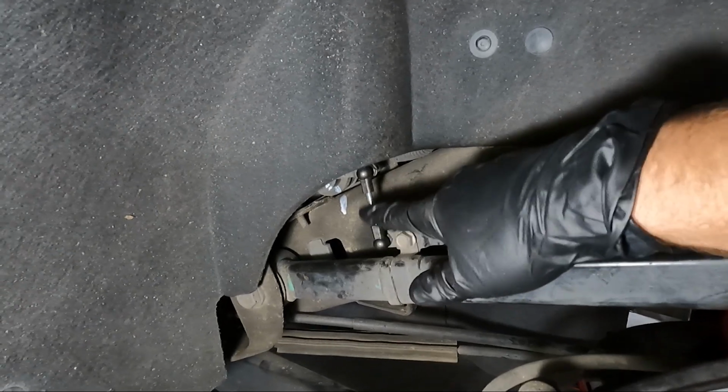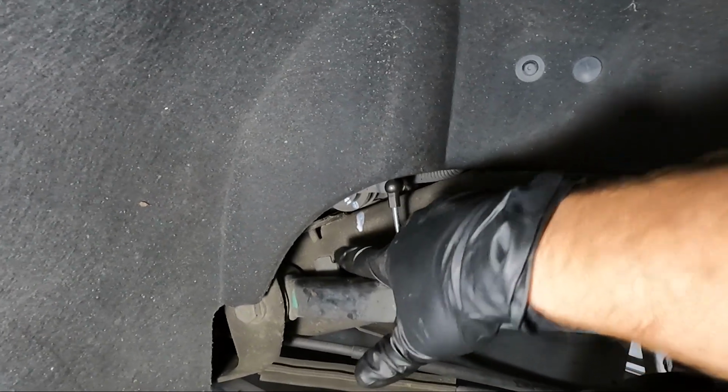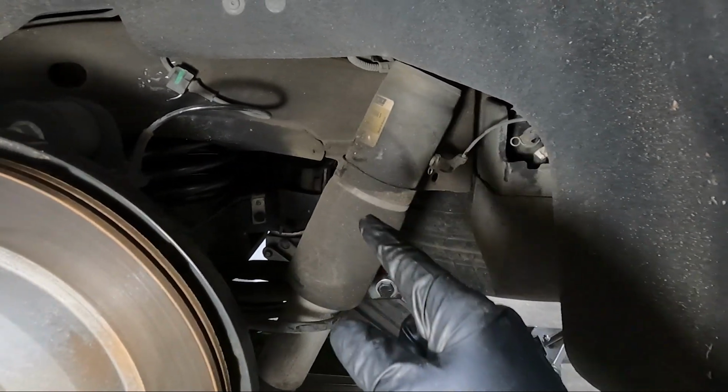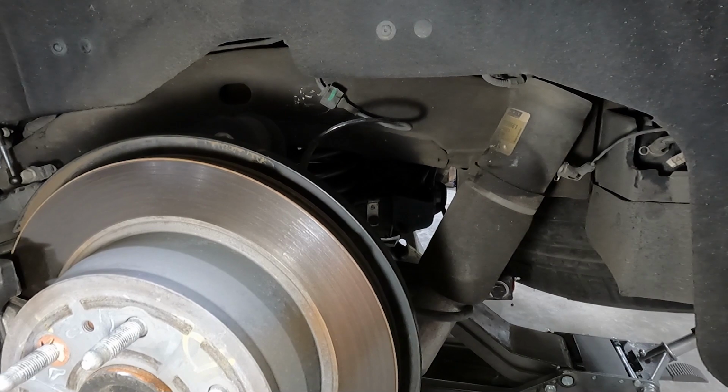We've got that piece of all thread cut. I put the ends on and just snapped it back in place, and check it out, our lines line up. So that's pretty much it for the back, guys. I'm gonna go ahead and put grease in the grease fitting of the sway bar end links. But other than that, we're ready to put the wheels back on.